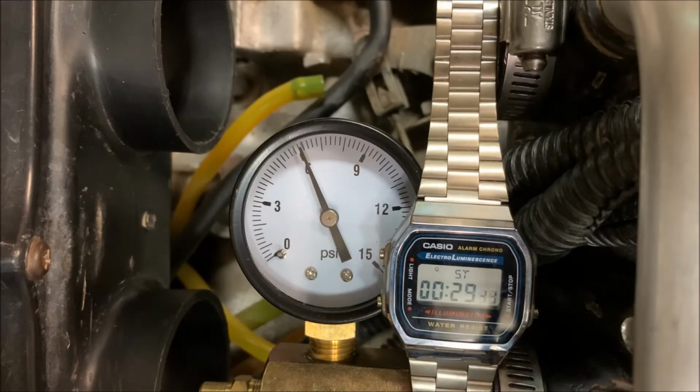Leaks can occur anywhere. It can occur at your cool head. It can occur at your regular stock OEM head. It can occur around your intake manifolds where they connect up. It can occur at your head, your base gasket, your head gasket, studs, case halves, behind the stator, behind the flywheel. It can happen behind your primary gear. There's a keyway. When you put your primary gear on, there's a keyway. And that keyway is a prime suspect for leaks.